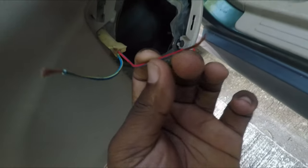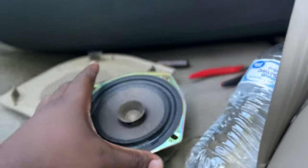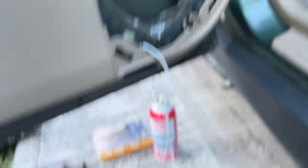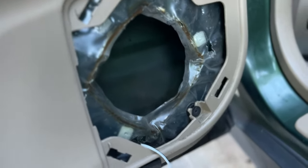I think blue-yellow is positive and red-blue is negative. I plugged in my phone, did a test, and it's actually correct. The GoPro died and I ran into a pretty big issue in terms of fitment — this cavity is super small. I have these six and a half inch speakers, same size as the front ones. They fit in the cavity pretty tightly; however, the nose kind of sticks out too far. So what I'm gonna do is modify this shroud — cut out the hole, try to do it as clean as possible.